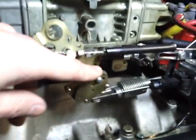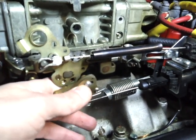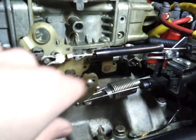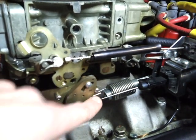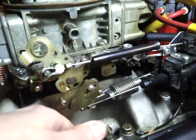This is also a Bowtie Overdrives piece. Other manufacturers make little adapter things to hook the throttle valve cable to as well. This particular one is like a little cam — once you give it gas, the cam pulls this cable out to where it's supposed to be. This is a corrector; it corrects the position.